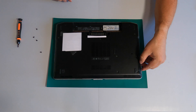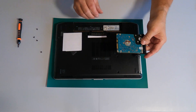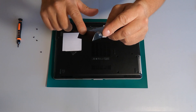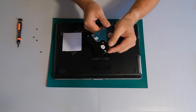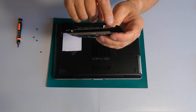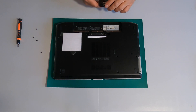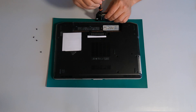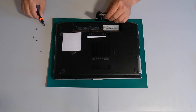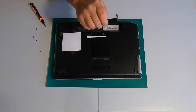We're going to put our fingernail around this lip on the bracket and slide it out. There you go — pretty easy, isn't it? You can see right here there's a screw. That's the single screw that's going to attach this bracket to the drive. Over here there's a little peg that's going to sit inside the other screw hole just to give it some hold. So let's remove that screw. Here's the screw — we'll set it aside. We'll set the hard drive aside but keep the bracket.